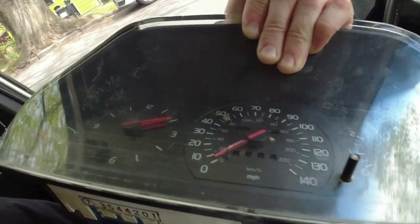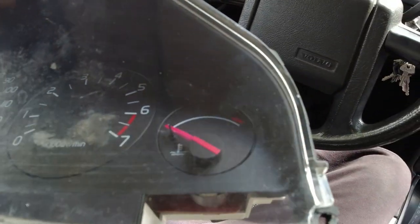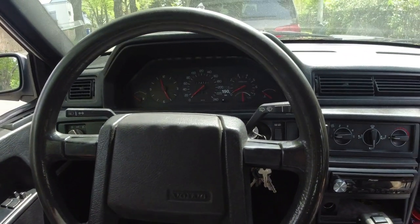I'd like to see if the other stuff is working - fuel gauge, tachometer, temperature gauge and that sort of thing - to see if we've got good components, and also check if the dash lights come on to see if we've got a good circuit board. So I'll have a little play with it, get some screws back in, plug it into the car, see if things work, then take it off again and swap over just the speedometer unit itself. Then we'll run with our original cluster.